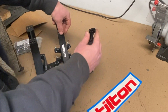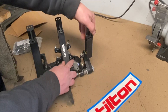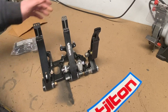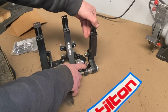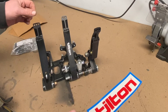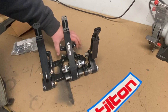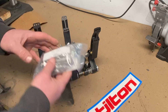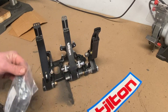Another one is the throttle pedal. The throttle has a stop on this side and a stop for when it's all the way down, so you're not going to snap any throttle cables. It's got a strong spring on it, so your return is good not only from your carburetor but from your pedal. It just gives positive control. It has a balance bar, so there's a front and rear master cylinder that goes on here. It comes with pedals — it's a pretty simple kit, but it's well engineered.